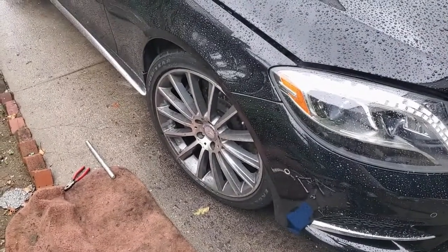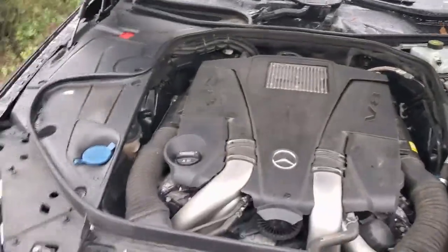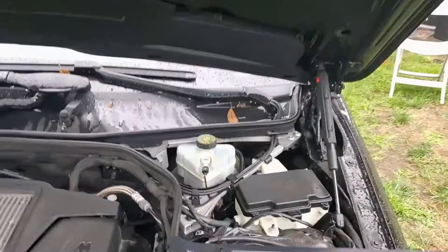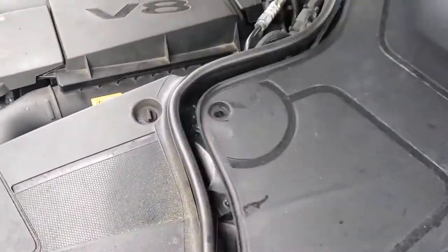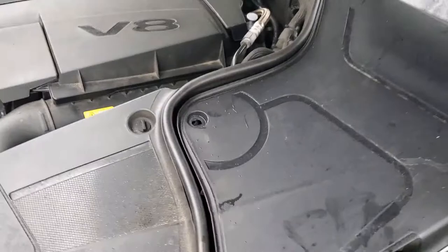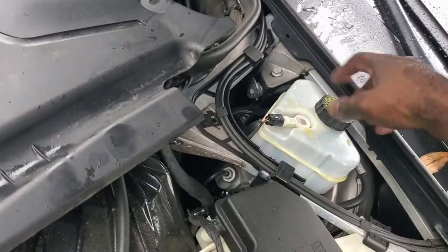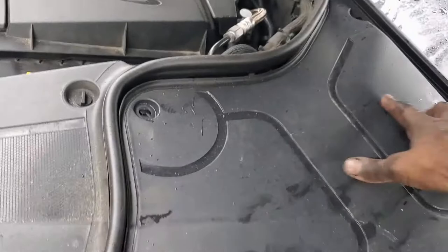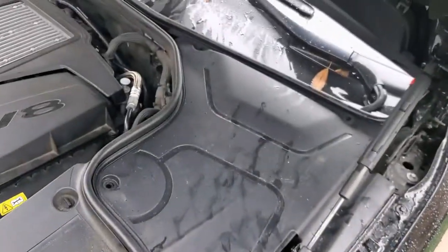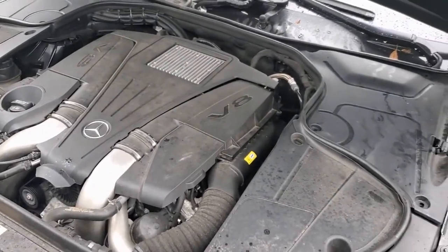After the wheel is back on the car — this is the passenger side wheel — we'll go ahead and open up the hood, if it's not raining, and put everything back. Put back the cover and put back each of the screws and tighten everything up. One thing we almost forgot — very important — we've got to tighten the reservoir cap. Now we put everything back, I'm going to put the four screws in and we're good to go. We get inside the car, pump the brakes — the brakes will be tight — start the car, pump the brakes again, and that'll be the end of it. From start to finish, that's basically how you change your front brake pad.